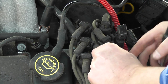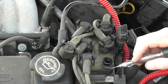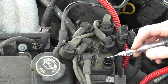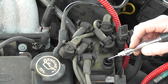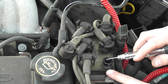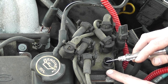Test light's connected to ground. I'll pull one of the plug wires off and look at two things: one, to see if I have spark, and two, to see how far it jumps. This electrode is way down inside the tower so I don't expect it to jump too far. If it jumps about an inch, that's what we're looking for. Go ahead and crank it. I definitely have spark — nice blue spark — almost an inch, jumping between my finger and the test light.